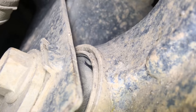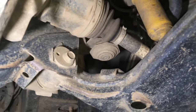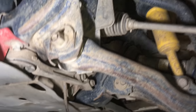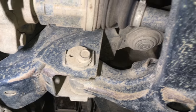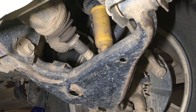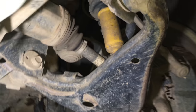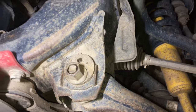It's got that little split just starting up that side there. The best way to look after these bushes is just look after them - have the right suspension, don't have it bouncing around on old flog suspension, and don't think that you can go jumping over speed humps because you'll flog those out. They're expensive, they're hard to change, aftermarket options aren't as good, and the whole arms are expensive. Brand new lower control arms in pairs are about $1,760 for the pair delivered.